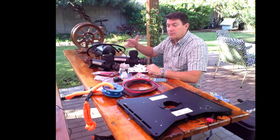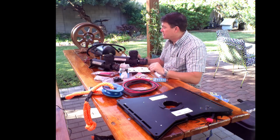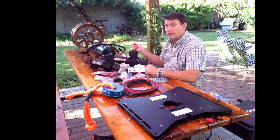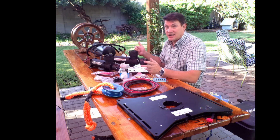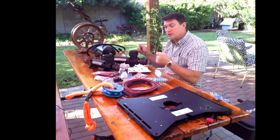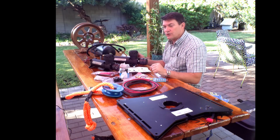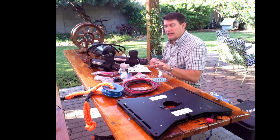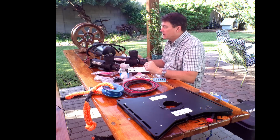And we're going to put the winch, the Mile Marker, that, again, they're supporting us. Full disclosure, I'm trying to make sure I'm full disclosure on all this stuff. We're going to do that on a receiver mount so that we can put it in the front or in the back. Because honestly, don't you need to go back to a point of safety? I mean, really, when you got stuck, weren't you in a good place first, rather than going farther into the land of doom? So I want to be able to move our winch point around so that when we're chasing in Baja, at the Mexican 1000, we can also just pull up, position the vehicle, winch, and not have to turn around and get lined up. It'll make things a lot easier on recovery.